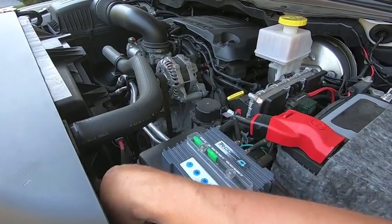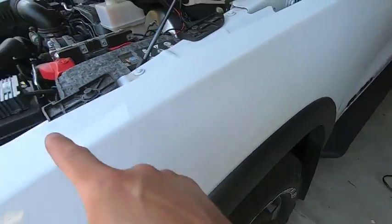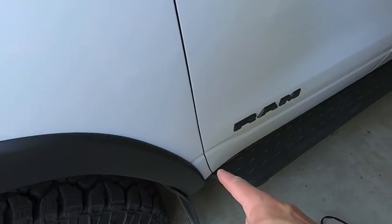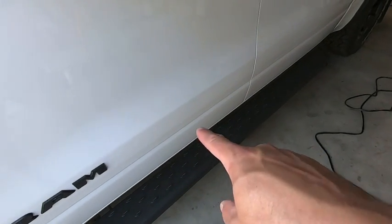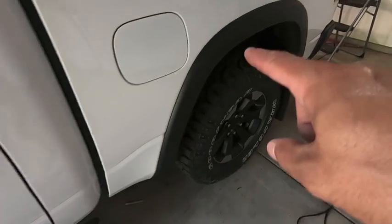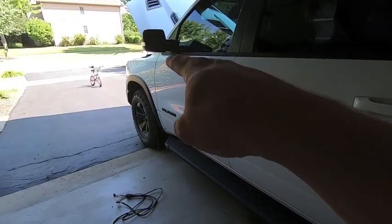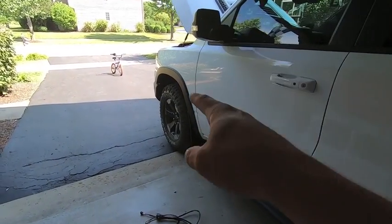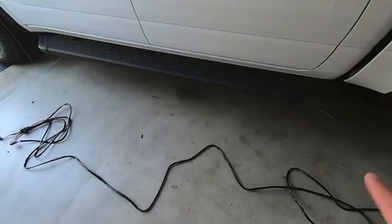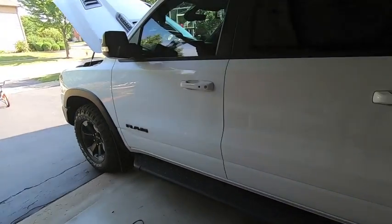As far as wiring, I'm gonna start here and then try to figure out the trickiest part, which is gonna be getting the wire from that portion around the fender and up against the frame. Once I get up against the frame, it's a straight shot here. Then once you get to the back, it's a little bit more manipulating. But honestly, the hardest part is getting it from that top fuse box there, dropping it down safely, and getting it around everything. I have plenty of harness between this and my AAC one, so if I have to take the long way to do it, so be it.